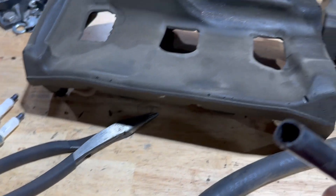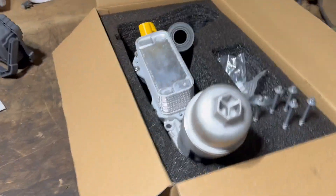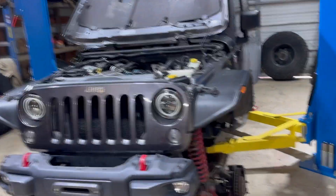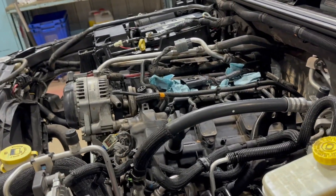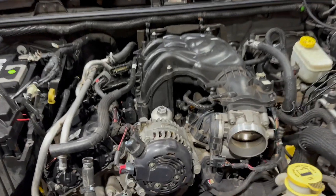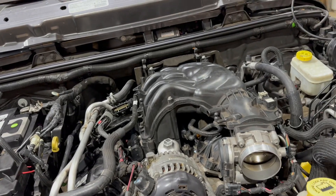This thing had a cracked oil filter housing, so I'm working on replacing it. I pulled the intake off and broke a hose, so I've got to order one of those. I got the new aluminum one — I'm going to throw that in. Hopefully that cures the big massive oil leak draining down onto the trans and all over the ground. Apparently it's really common on JKs. I did valve cover gaskets and the updated aluminum oil cooler filter housing.